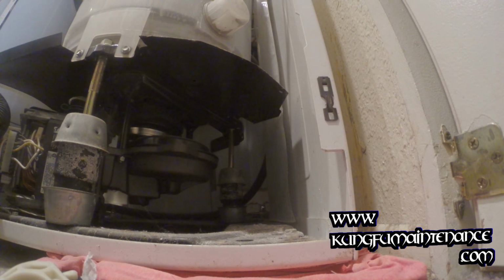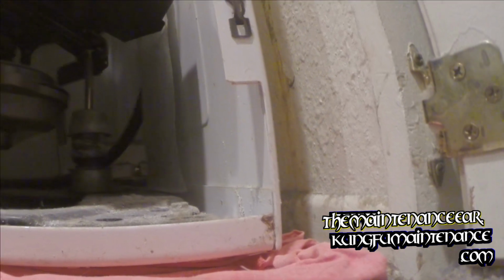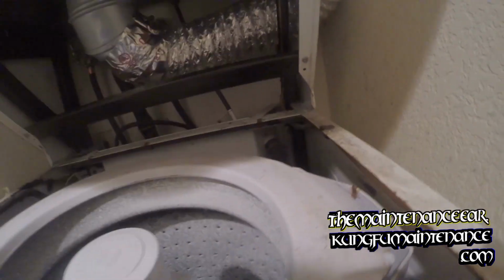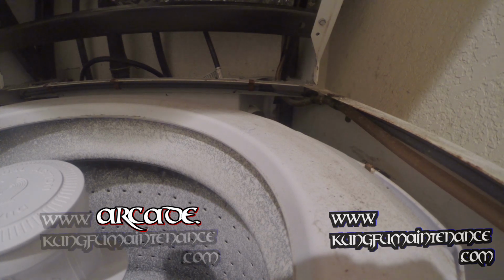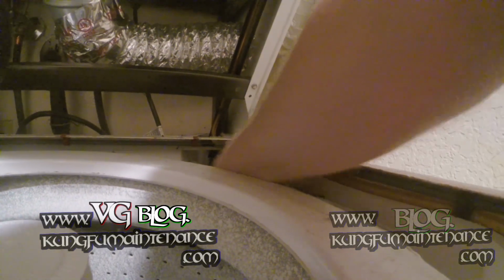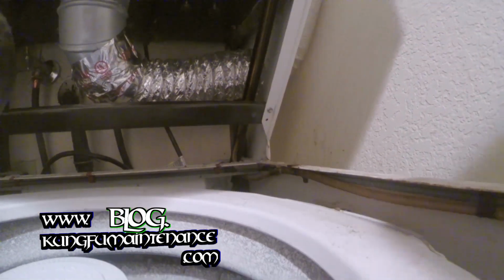I'll disconnect it there, and I'm going to replace that whole hose. So I disconnect it anyway. Vacuum hooked up and ready to go. Now we're going to pull that hose off, and then we'll vacuum from there, and that'll clear any water that's left in the bin. Makes this whole job a lot easier. It's really one of the main secrets to working on a washing machine. I used to have to deal with the flood underneath the washing machine every time before I developed this trick.